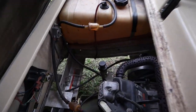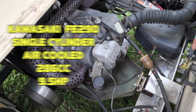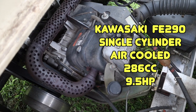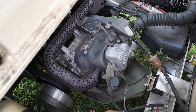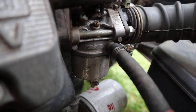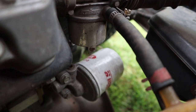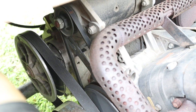Another thing people really like about Club Car models is that they have a fully aluminum chassis, which not only makes them lightweight and durable but they simply last forever because they don't rust away. This 2005 model has the Kawasaki FE290 four-stroke gas engine. It runs quiet and steady at a low RPM — pretty much bulletproof. This engine predates any fuel injection so it's carbureted, but it works great. You can see the easy-access oil filter located just below.